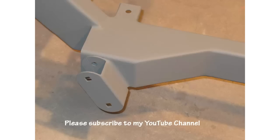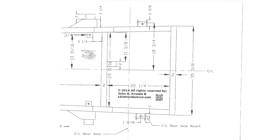Since I'm going to use carriage bolts to mount the dog bones into this bracket, I needed to make the outside holes square. The Brookville Roadster body that I purchased was set up for a rumble seat. This was all removed, including a few of the cross members in the body, to make room for the chassis that had a 4-inch kick-up at the rear.